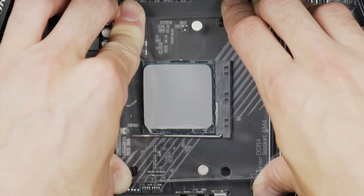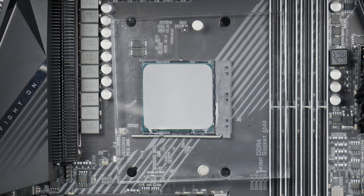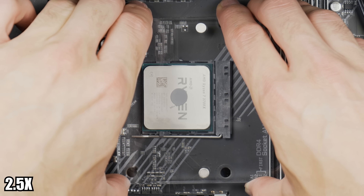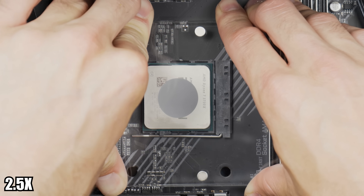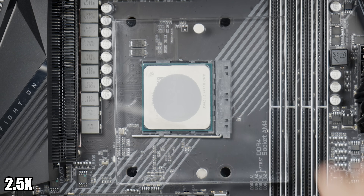Overall, the spread method is good, but it comes with the issue of possibly getting air gaps trapped in there — which leads to a suggestion from Alien Kitten that we'll get to later. Our final standard method is the tiny dot, to see what it looks like when you apply too little thermal paste. No surprise, it leaves us with a small circle. We already found out you don't need thermal paste at all to survive, but you're not going to get the best temperatures.